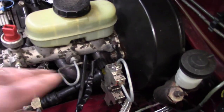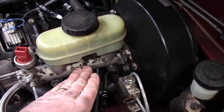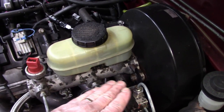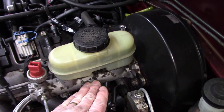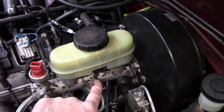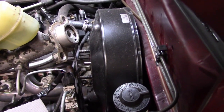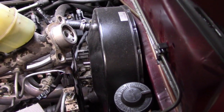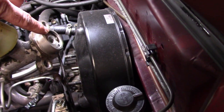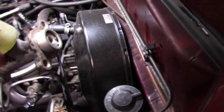There's an additional modification that needs to be made and it is super simple. I'm going to disassemble this and show you exactly what has to happen — it is just a minor little adapter that slips inside the bore of the master cylinder. The only thing required to mechanically connect the factory Mazda brake pedal to the Ford Explorer plunger inside the master cylinder is this little adapter.